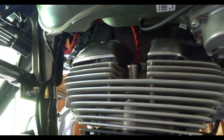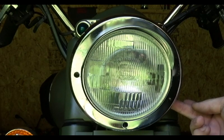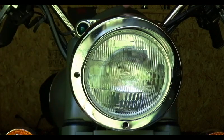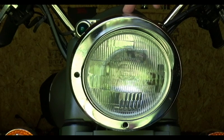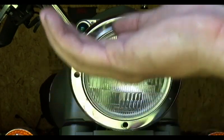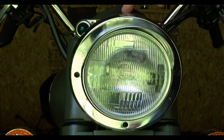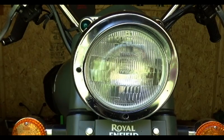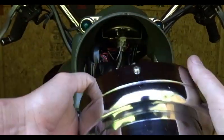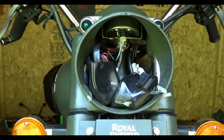And we're finished. Let's move on to the Smith-style speedometer. The first thing I want to do is remove the entire headlight assembly in one piece. To do that, you have three screws: two on the bottom — one on each side — and one on the top. The one on the top is a tensioner that holds everything together, so you do not have to remove it completely. It has a little mechanism shaped like a bracket, and when you tighten it up it pulls up and holds everything together. About four to six turns on this — you don't have to remove it all the way. With the top screw loosened and the side screws out, work it a little back and forth and it should just pop right off. Then disconnect your headlight and we're ready to move on.